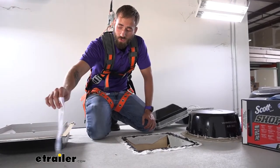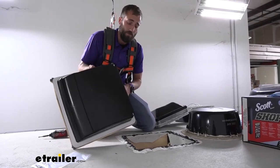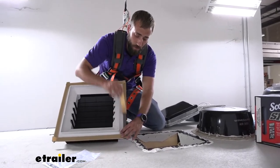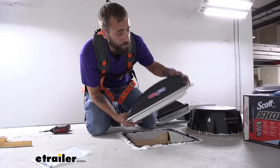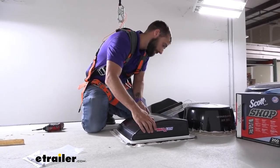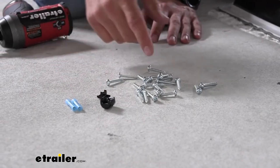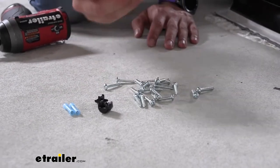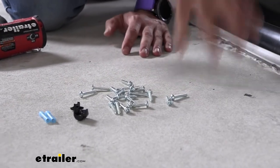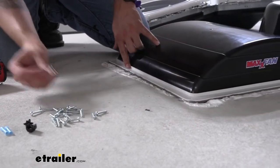So let's go ahead and start our installation of the Max Fan Mini Plus, which will fit here because it doesn't have that big scoop sitting off the back. We already have our butyl tape on, so we'll remove our backing and place it so that the vents are on the back side, then drop it into our opening. You're going to have two hardware bags — one with two butt connectors, a little plug for wiring, and these screws with a rounded head that go in the flange of our vent cover to hold it down to the roof.